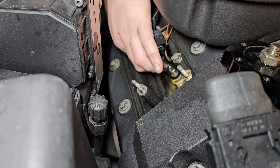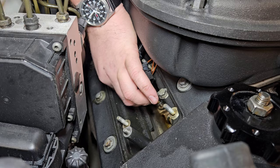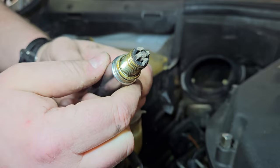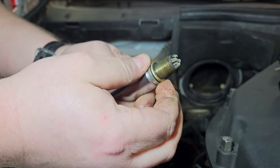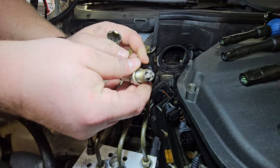I would think it's going to be two or three — somewhere in the middle because it wasn't right on the end of the cycle between one and eight. Usually if you've got a cylinder one or a cylinder eight that's down, it shakes the car a lot harder, especially bad in four cylinders. I'm kicking myself for doing what I did but the car still runs and it's pretty good. This is a lot of my cold start issue, and when the oil gets really hot and I'm driving it hard, it'll start to shake a little bit. You can feel like a half cylinder running — it's got a weak spark instead of full strength. Your little electrodes are completely covered anyway.